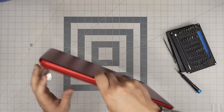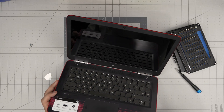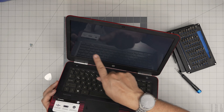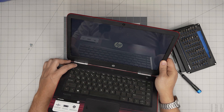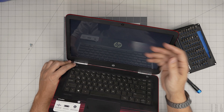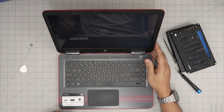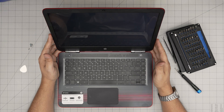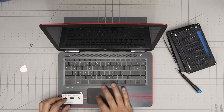Let's power it on so you can see that CMOS message. It does one flicker and should give the message — but if you didn't hold it long enough you may not see it. Don't worry if you get that message; just press enter, it will restart and simply load Windows with no problem. I hope this video helped you with your RAM upgrade for the HP Pavilion 14 AV-005. If you have any questions or requests, leave them in the comments and I'll try to answer them as soon as I can. Thanks for watching and I'll see you in my next video.